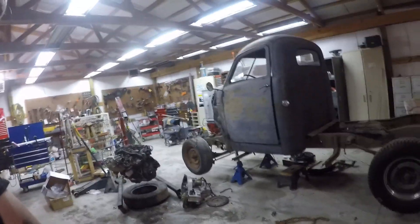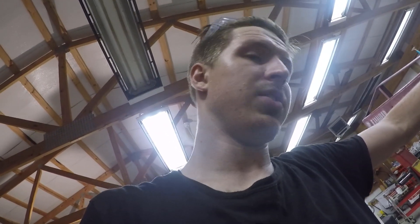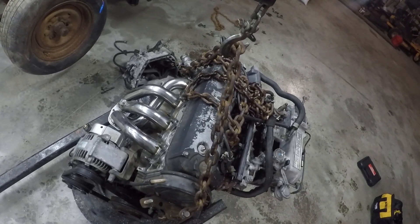I've cleaned up and taken it all apart again because I'm going to have the flywheel resurfaced, replace the rear main seal, probably the oil pan gasket, and some stuff up front. I definitely need to replace the valve cover gasket — it's leaking really bad into the spark plug holes. A timing belt probably wouldn't be a bad idea either. Stuff like that should hopefully keep it going. This is mainly so I can rebuild my D15 in my Civic since it needs it, and it'll be a little bit faster with this engine.